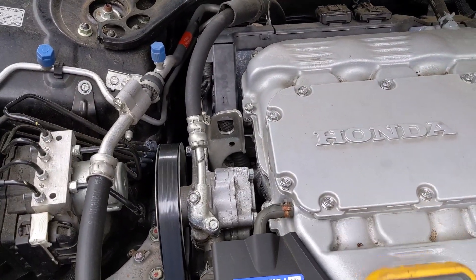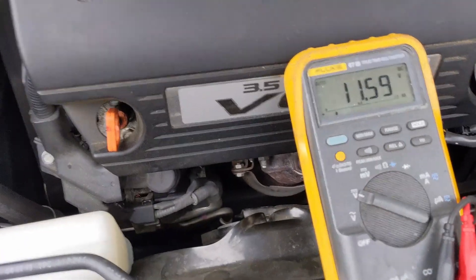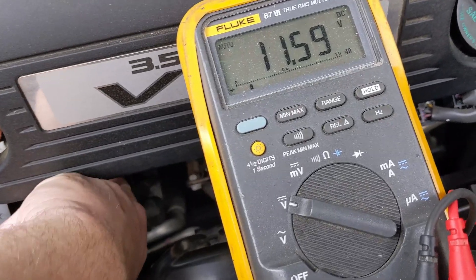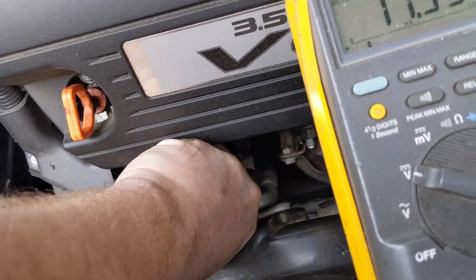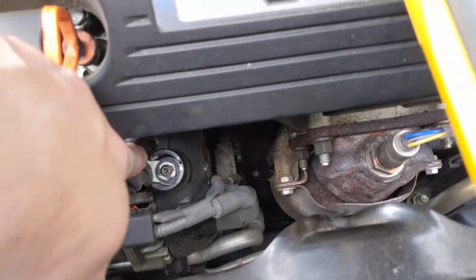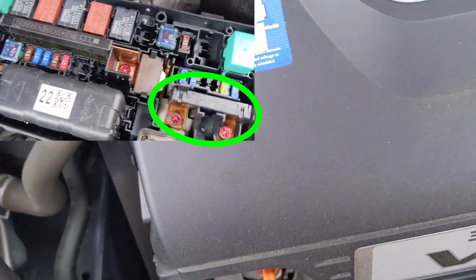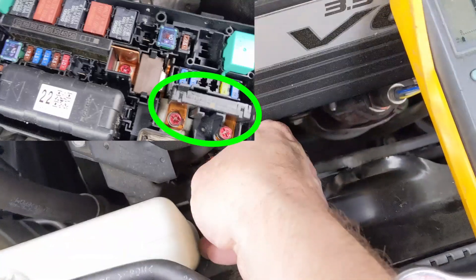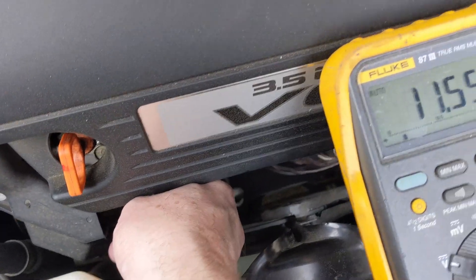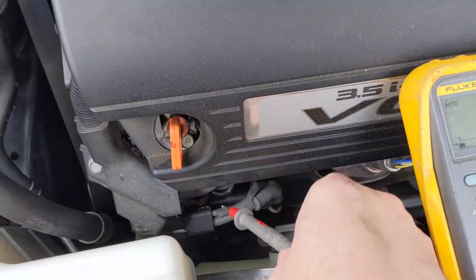Usually if you're having voltage and current fluctuations, the ELD might be an issue, but we seem to really not be charging at all. I'm going to pull this cover off, being careful with the fan running, to get my meter lead and check straight on the alternator. I've already checked my fuse and it's good, but just to make sure it's not a broken connection somewhere. I pull the little boot up and get my probe on here — 11.55 volts, same thing at the alternator.